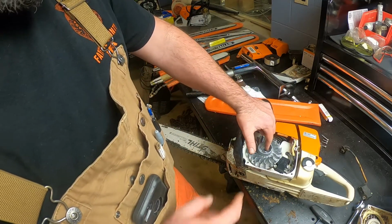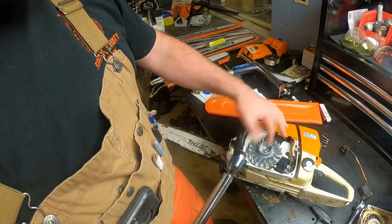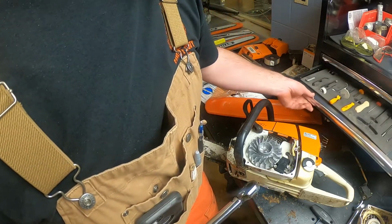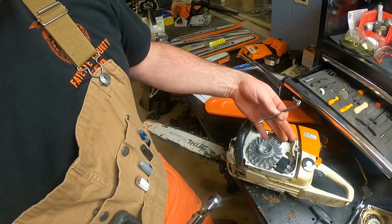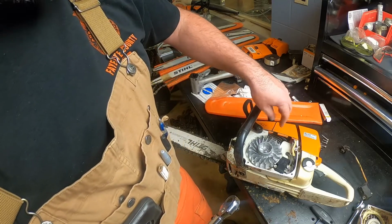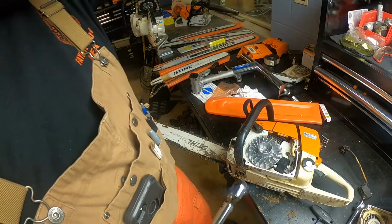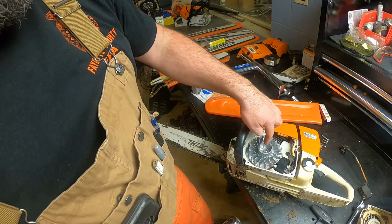But when we put this back on, we used our torque wrench, torque that with the piston stop in. Pull the spark plug out, install the piston stop. But you saw that done when we took the flywheel apart, or removed it. You slide that in there, and then rotate it up. Again, be careful not to cram that in the exhaust port, but make sure it is on top of the piston, right at the top of the cylinder. And then you release it.